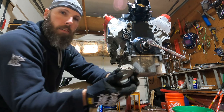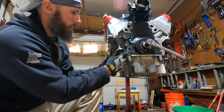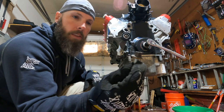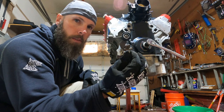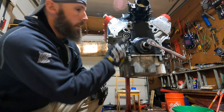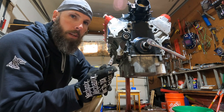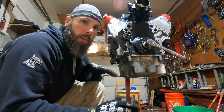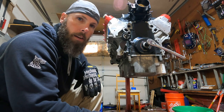All right, 37 foot-pounds. All right, guys, I already took this off earlier, but this is the tensioner pulley for the air conditioning. Now, if you can see the little tab right there, that's gonna go inside that hole, so when you mount it back up, you stick it in the hole, bolt it up, you're good to go. The one it comes with is a 13 millimeter socket, so when we go to put that on, I'll tell you the torque specs. I'm gonna Loctite it, crank it down, and go from there. But first, I gotta get this off. Now that takes a Torx T50. I hit it with an impact gun, wanted nothing to do with it. So I'm gonna stick this in, try a breaker bar. If that doesn't work, I'm gonna put a little heat to it, hope that works, and we'll continue on. We'll just swap it right out.